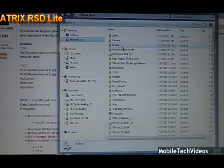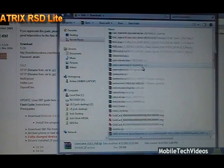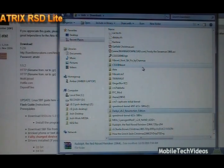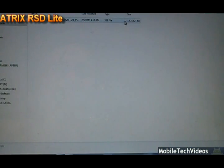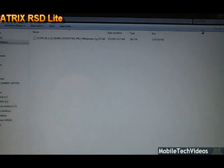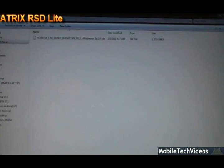After that, we can take a look at what's in the file. Go to your downloads folder and into the atrix directory. There's lots of phone stuff in this directory. We can see our image file — it's 1.4 gigabytes, which is massive, but that's kind of the going trend. Things are getting bigger with 2.2.1, 2.3, and actually today I found out that Ice Cream Sandwich is the official name of the next Android release. The file format you're going to see is an SBF file. Keep note of where this file is on your machine.